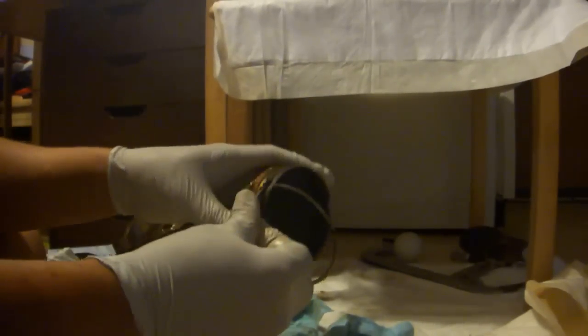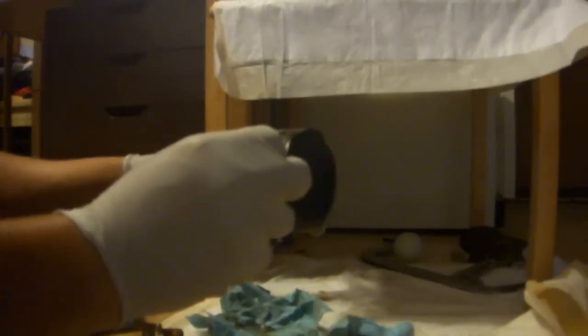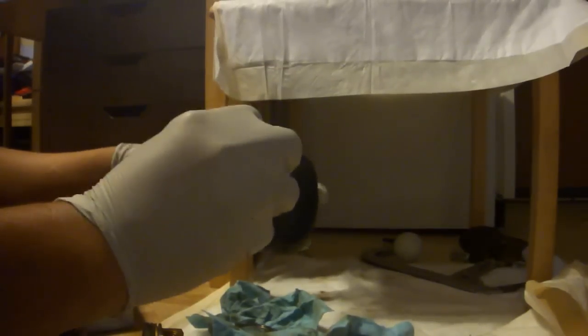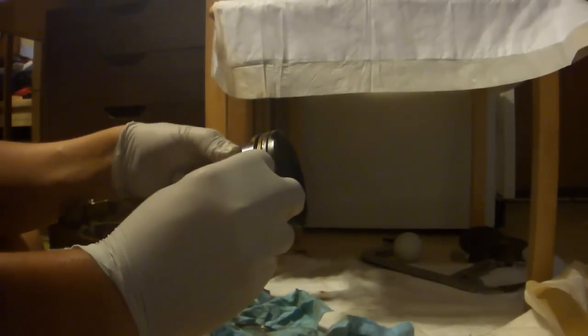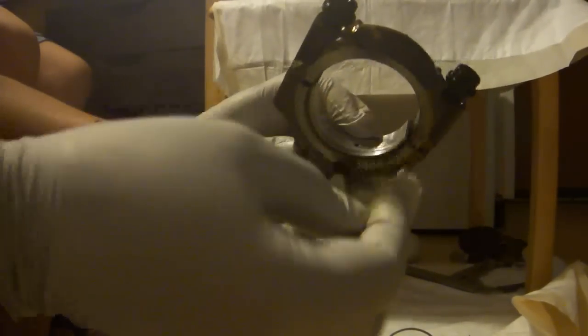Use the bent and broken piston ring pieces to clean the slots in the piston. Simply set the ring into the slot and run it around to remove the gunk. Use the first bent one for the upper ring and the second broken one for the middle ring. Once you have that cleaned, you can use the broken piece to also clean out the third oil control ring area.